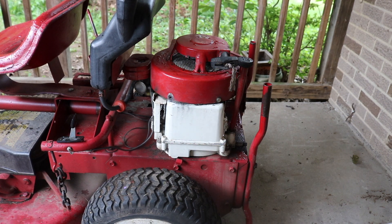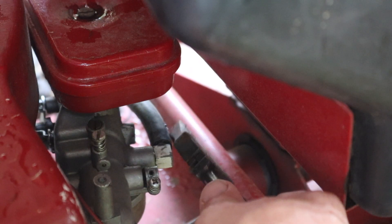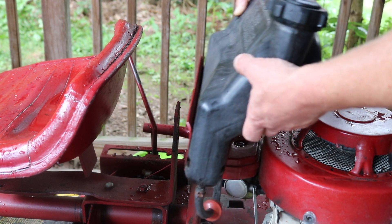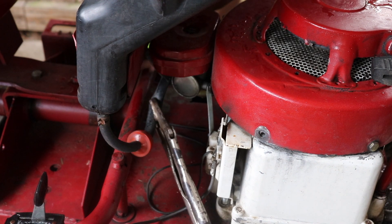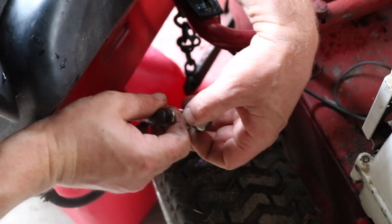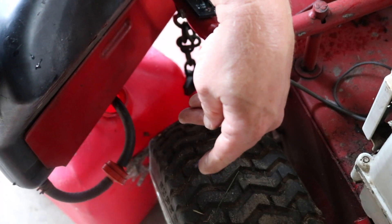The first step is to loosen these bolts and take the engine off. I'm going to detach the gas tank and drain it safely into a gas can. The nicest thing about a Snapper is the gas tank comes straight up, so it'll be easy to drain it wherever we want. I've got a pair of vice grips on there to stop it from leaking. I'll use another set of pliers to pull it off. My goal is to not spill any — just put the hose inside the gas can and let gravity do the work.